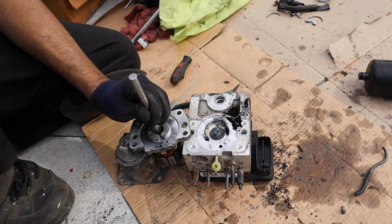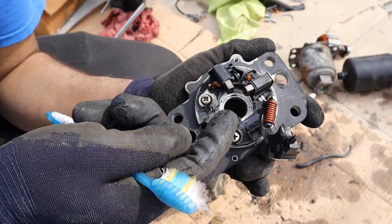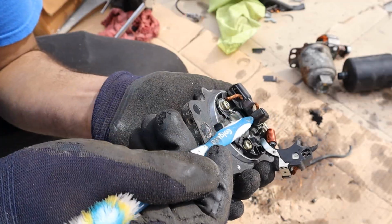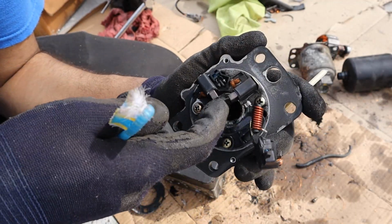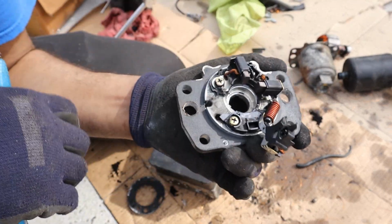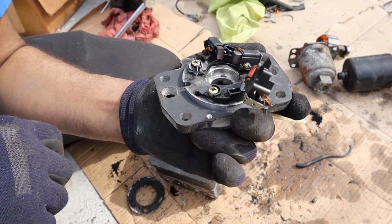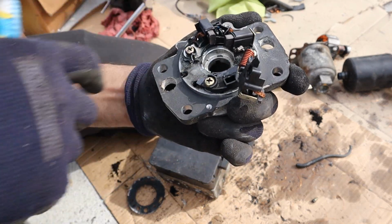Now these motors are actually a brushed motor, which means they do have a limited lifespan when these brushes wear down. You see these ones have little grooves in them over here. I'm surprised they didn't use a brushless DC motor or another solution, given that this is a critical safety feature of the braking system. And you will have to replace this if it wears down and the motor can't spin anymore.